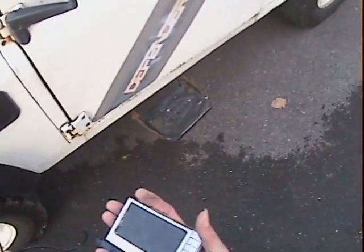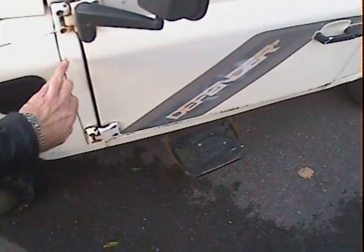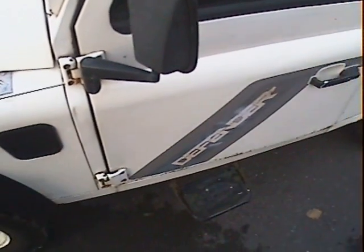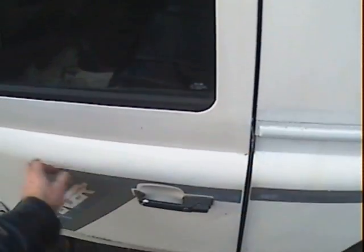The bulkhead up here is all nice, the screen is good, and obviously the roof rack is superb. There's a little bit of reaction coming up around the hinge here for the screen, but that's all fine. The check strap on the passenger door has failed at some point. There's a small dent in the bulkhead, which they always get, electrolytic reaction on the bottom of the passenger door — very normal — and some electrolytic bubbling just here on the door top.